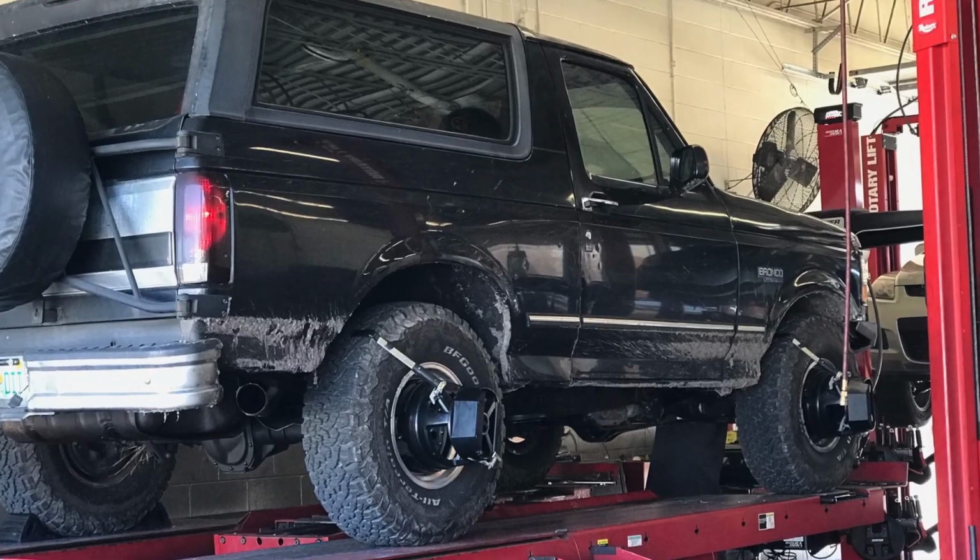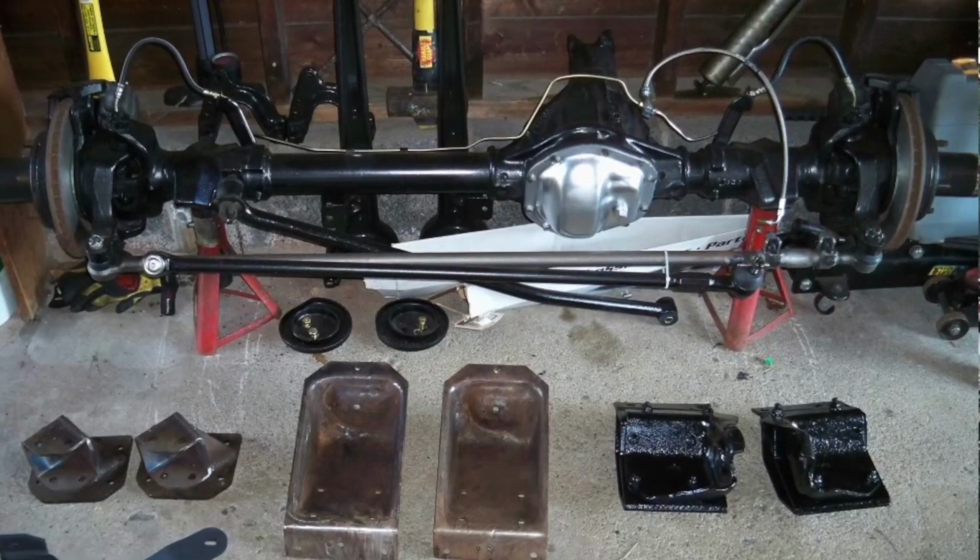Really, the thing about those twin traction beams, you get a little bit better ride, but mind you, this is an old truck, 20 plus years old. In normal day-to-day driving, you do run into tire wear issues, especially with these. It's hard to dial in the alignment really well with the twin traction beam suspension system. But that's something I'd like to change in the future. Maybe go to a solid axle Dana 44 out of an older F100 or a Bronco, like '78, '79, those kind of years have those straight axles.